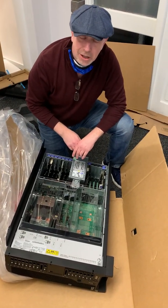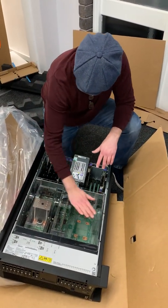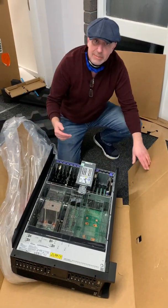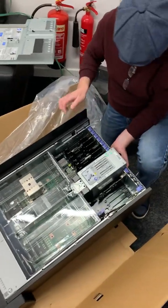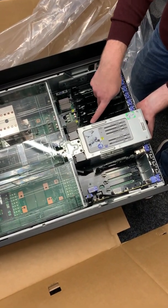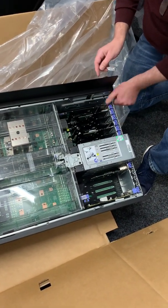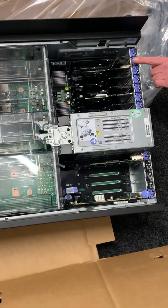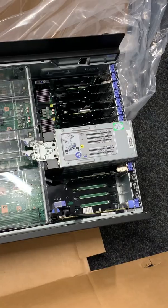Inside there's a lot of space, a lot of air — and that's a good thing because with that air comes the ventilation. This plastic clip on here is forcing airflow. The reason we're looking inside: at the back we've got adapter cards. In this case I've got a network card, a SAS tape adapter card, and another network card. I'm looking to make sure they're flush, pushed in, the back end isn't raised, and that they're well seated. They're seated — they'll be flush, not sticking up, not jagged — and when I look at them from the back they'll be nice and straight. That one looks good.